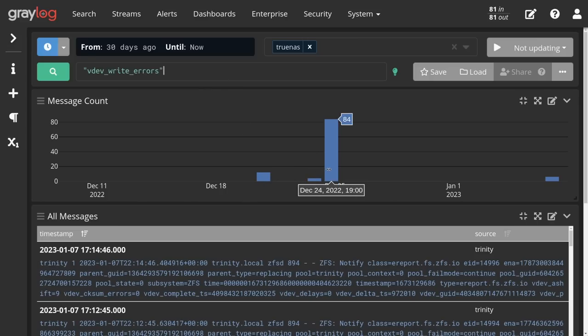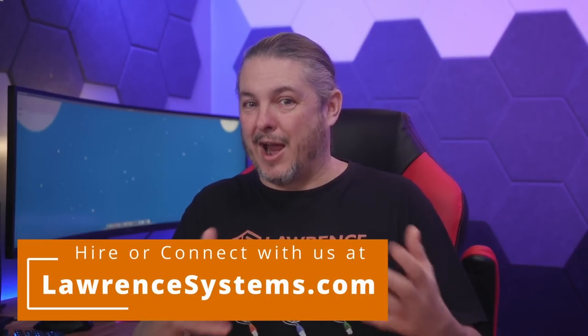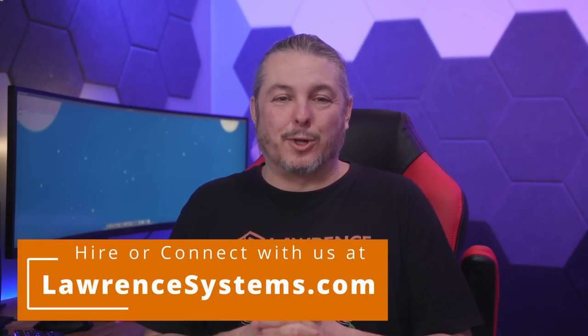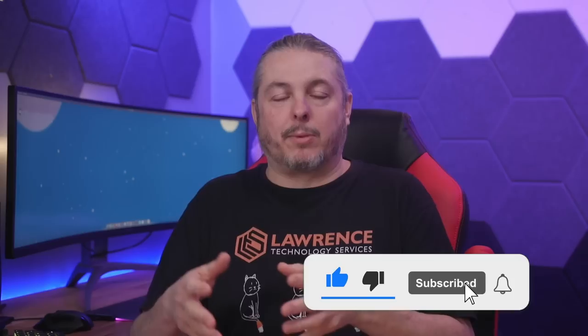So I actually took the drive. I wanted to try it in a different slot. So I erased the drive and put it in a different slot, tried to resilver it, and that resulted in more errors. So that pretty much concluded it, and I feel as though I did my due diligence making sure that drive was bad. So now I want to walk you through the process for how you replace these drives.